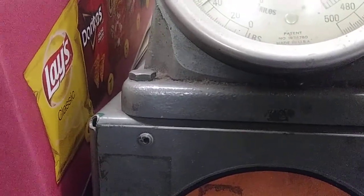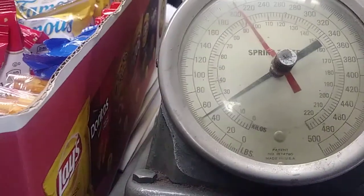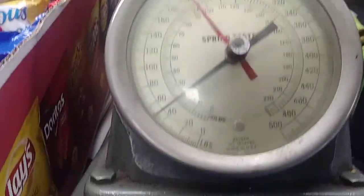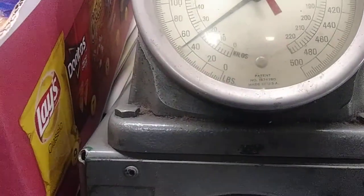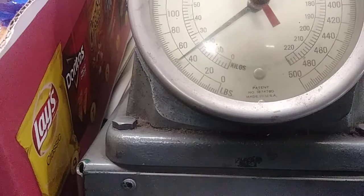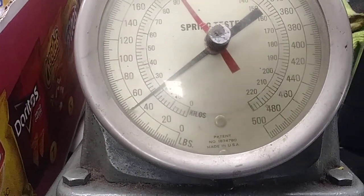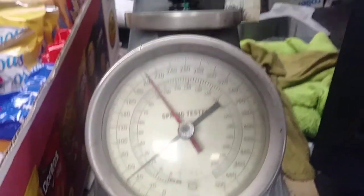Let me go down to seven eighths. At a 0.875 install height for the green stripe, it's about 50 pounds — I keep saying 45 but that's actually 50. The line in the middle was about 49, almost 50 pounds.